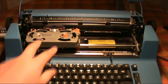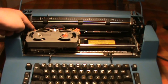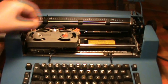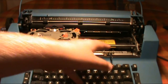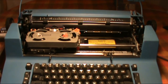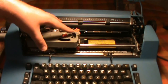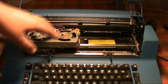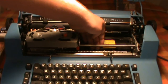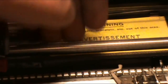Here you have the inner workings. This is your ribbon cartridge with carbon ribbon. These orange spools are correction tape. This is your golf ball typing element. And then of course the margin sets and the platen. This system — in this case the carriage that moves instead of the platen itself — is assisted by a main drive belt located over here.